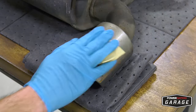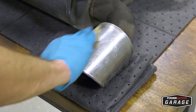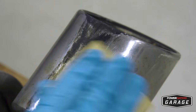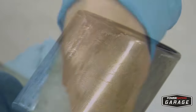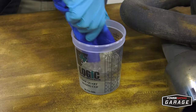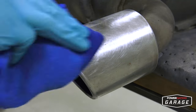You're going to need some sandpaper and you're also probably going to need some hand protection. I use these blue gloves because you're going to get them dirty. You want to take your sandpaper and remove all the rust and impurities from the top of the chrome. It's hard for paint to stick to chrome, so take your time and get all the impurities out — all the soot, all the dirt from in and around the exhaust tip, anything that you're going to be painting primer.